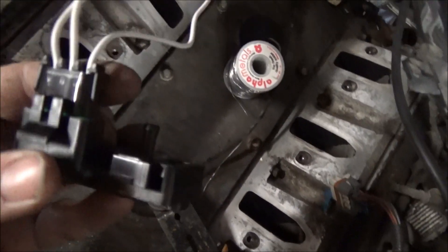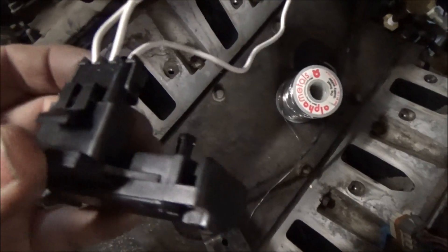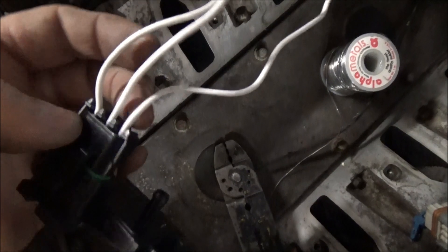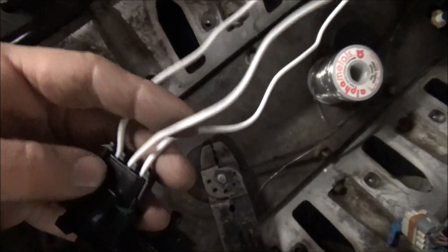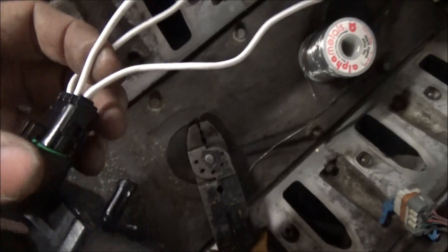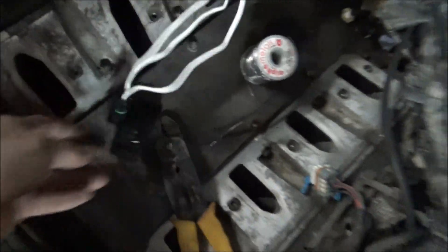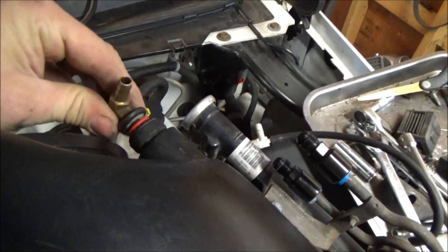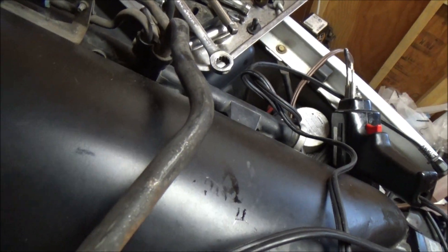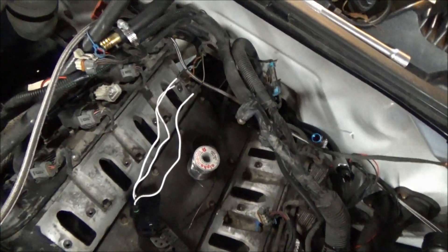All done. Just remember when you hook up your GM three-bar MAP sensor — and if you buy a plug-and-play harness from us this is already done for you — you want to connect A to the orange with black stripe, B to the light green, and C to the gray. Then connect this to a vacuum source with a vacuum hose. If you're using a stock truck intake you can leave the stock MAP sensor in there unhooked to plug the hole, and add T-fittings and vacuum hoses as needed. Most trucks also have a vacuum fitting up here. I'm going to go ahead and put the intake on, bolt it down, and start clicking all the wires into place and routing everything.